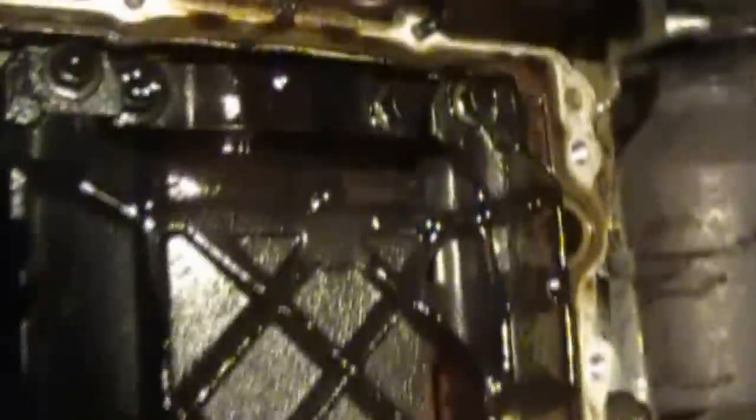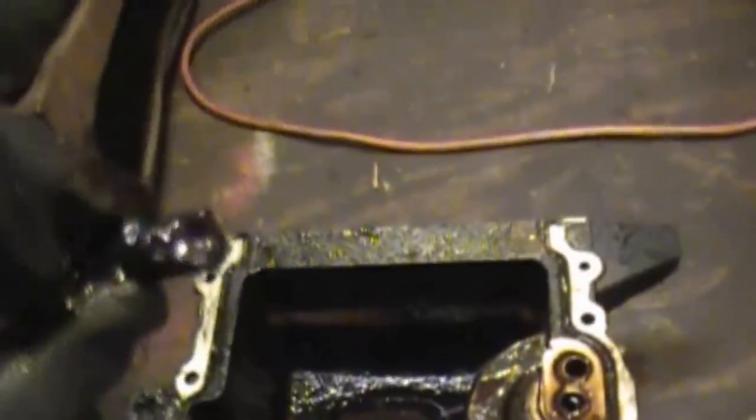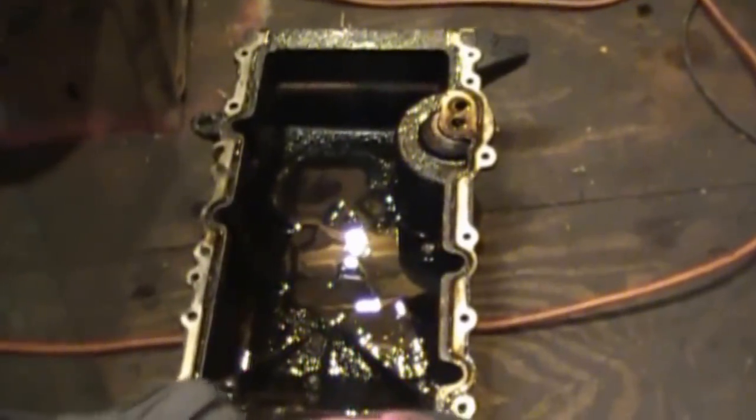Let me show the oil pan - there's some crud but not too bad. I've seen worse. There are pieces of the timing guides actually in there. I'll clean this out and put it back. The only thing I'm waiting on right now is my chain and guides - they haven't come in yet, hopefully tomorrow. I did clean up the cylinders pretty nicely - just took a drill and polished them up a little bit. If you're just replacing the chains on the front of the engine, you're not going to have to pop the heads off.